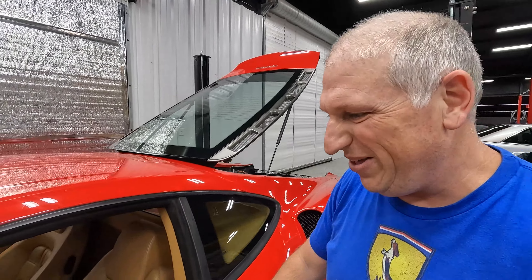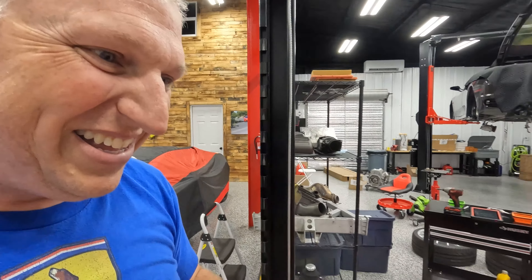I'm going to bleed it one more time because I think it may have sucked in air. I'll drain it, start it up again, and try once more. We're going to turn the bleed mode on again, start the car, and wait for it to pressurize. We can check the pressure on the Launch — still really high, but there it goes, now it's pressurizing.